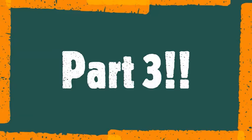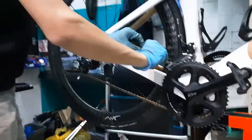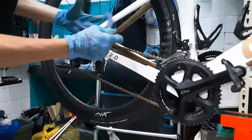Hold your wheel down, and then push hard onto your crank. This will cause tension in the upper part of your crank arm and the upper part of your chain. I can show you a quick example by undoing the quick link, using the tool here so that it looks faster.